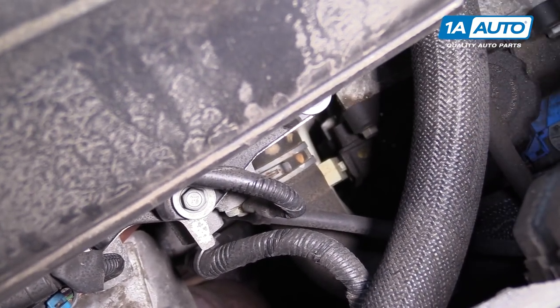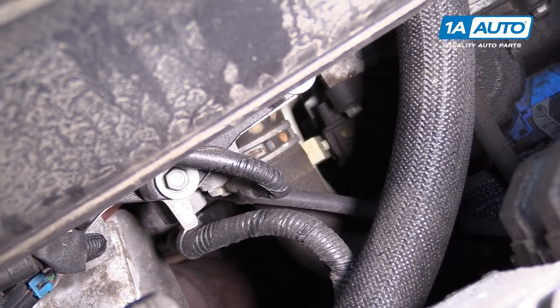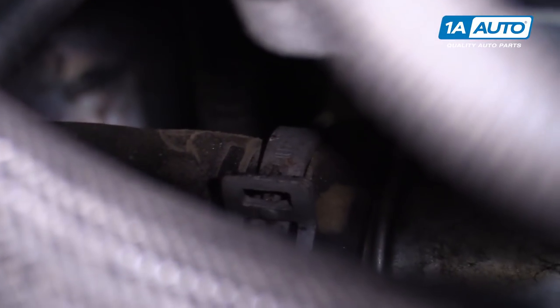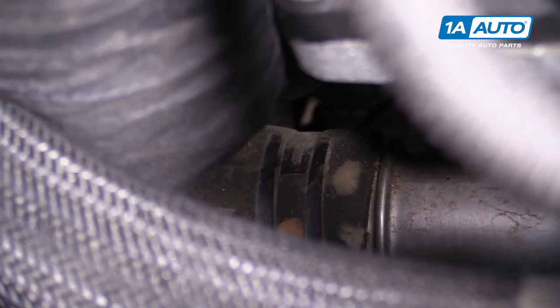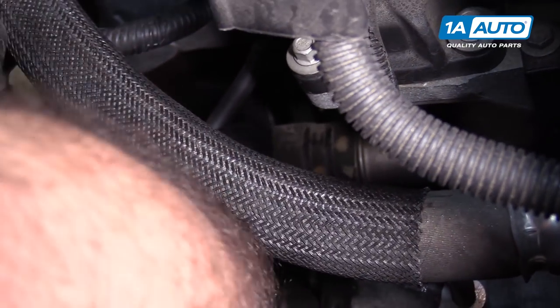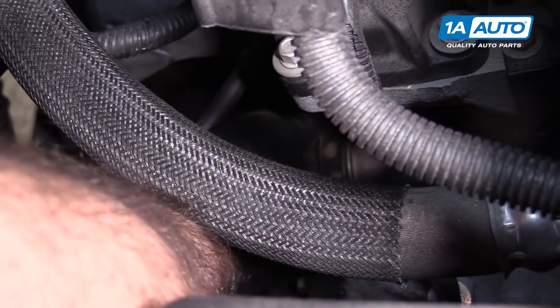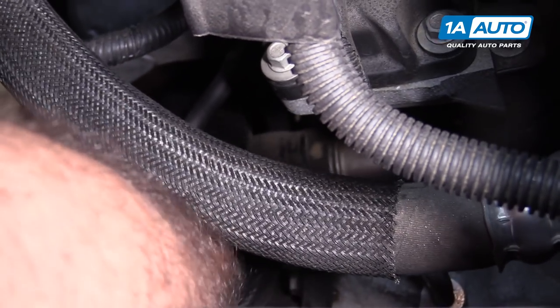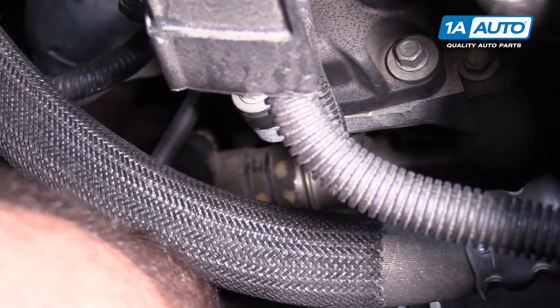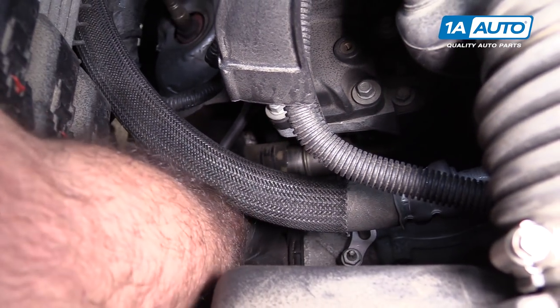The clamp would be the same on the bottom one. I'm just using some slip joint pliers. If you squeeze it just the right way, it's got a little lock — it'll lock together and I can slide it down. Now I'm going to work on getting that hose off. You should always do this when the vehicle is cool. It's going to come gushing out here.